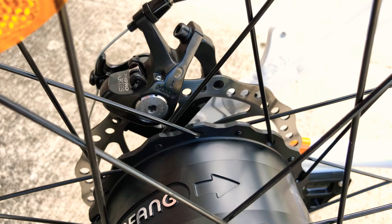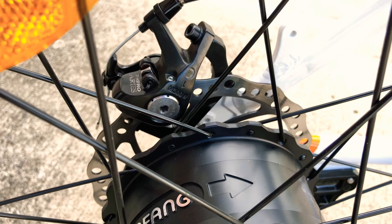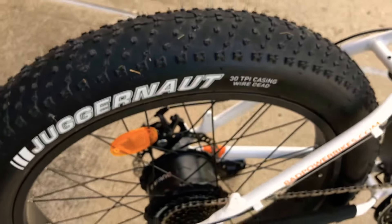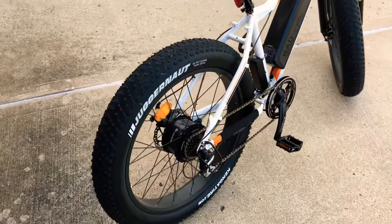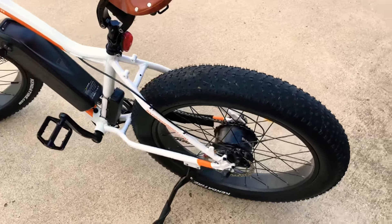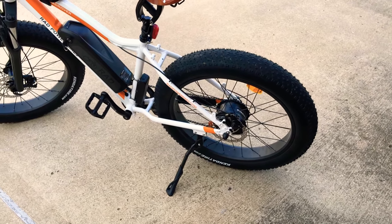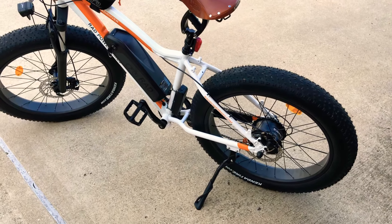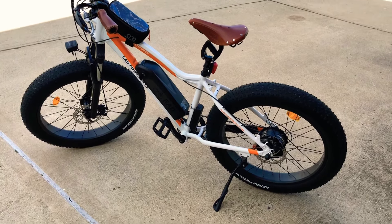You could slightly hear the pad rubbing on the rotor, but I rode around the block and it kind of evened out — it's not rubbing anymore, and that noise went away. So if you're trying to troubleshoot that — I thought it was the spokes, I started worrying something was wrong. But I was finally able to track that sound down and that's all it was. If anything else happens I'll make an update video, but I'm getting ready to go for a ride. Peace.